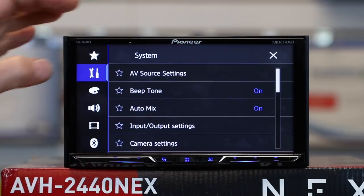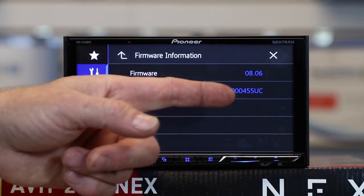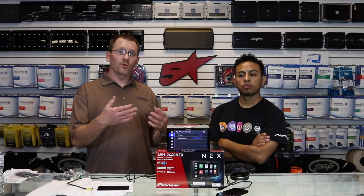One more important thing: go to gears, scroll down to system information, tap firmware information. Firmware updates are very important — Pioneer does about three or four a year, and each one generally fixes something that's gone wrong on the radio. With Android Auto and Apple CarPlay constantly updating their platforms, this radio also has to be updated, done through a USB thumb drive. Periodically go to pioneerelectronics.com, check under your radio's model number in the support tab, and see if there's been an update. If you register your unit, they'll email you when there's an update available — trust me, you'll want to do that.